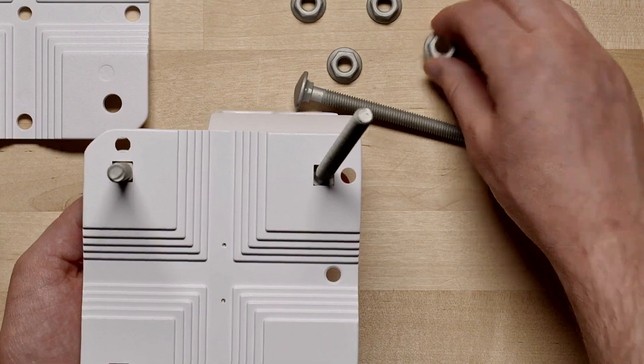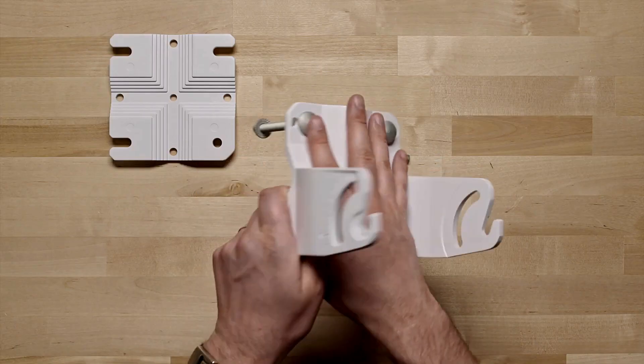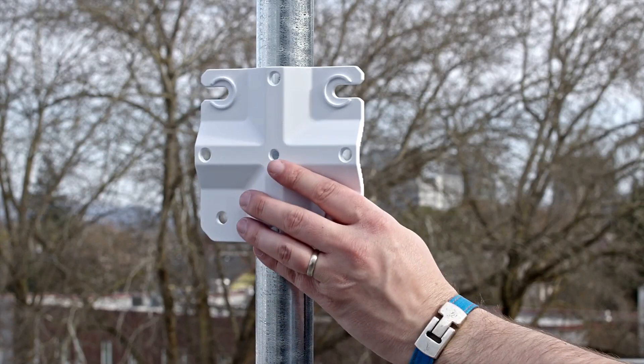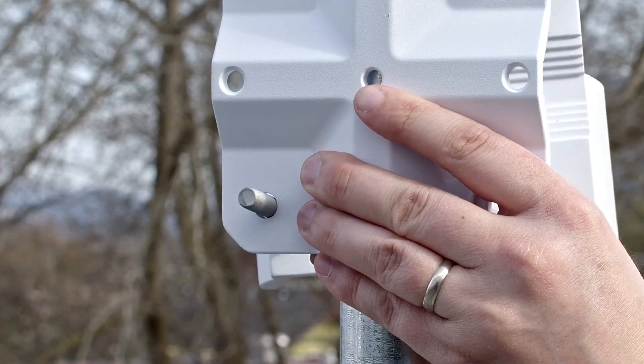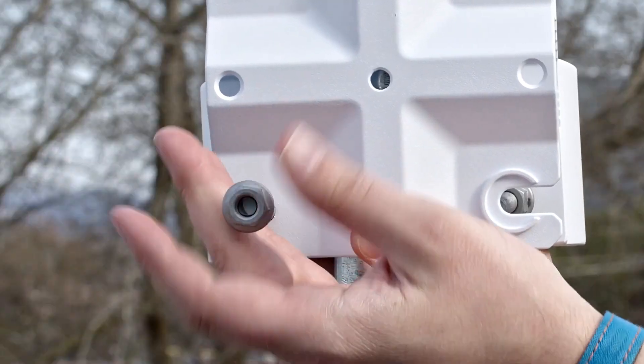Superior capacity for large crowds. Featuring low-latency QoS (quality of service), the Unifi Wi-Fi Base Station XG supports up to 1,500 clients with 12 MU-MIMO chains — 500 clients with 4 MU-MIMO chains per client radio.